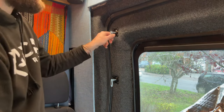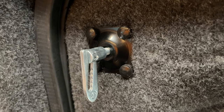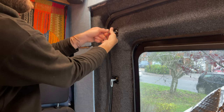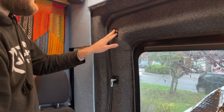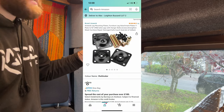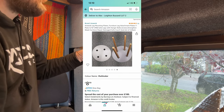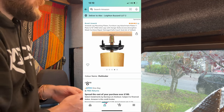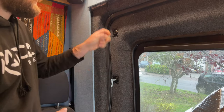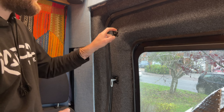For the attachment method, I've used what I believe are called anti-loose bolts. When I'm not using the window coverings in summer, I can just have them unscrewed and just have these plates on the windows. These plates are actually furniture leg plates from sofas. I ordered them off Amazon — they're pretty much a plate with an M8 bolt threaded into it. You just screw the M8 bolt into the middle; they're self-tapped with a cap so there's no cold bridge between the steel.